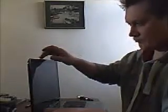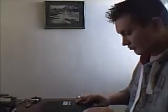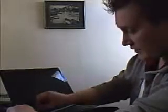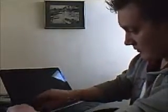It's on. Turn it off. Remove the battery. Okay, with this particular model, there are no screws around the frame, around the bezel, so the bezel just comes off. I like to use a very small, fine screwdriver and attack it at the hinges. Get in underneath those hinges and pop them out.